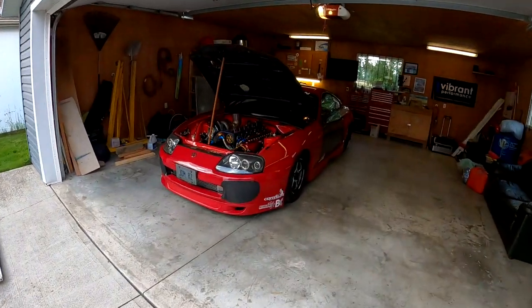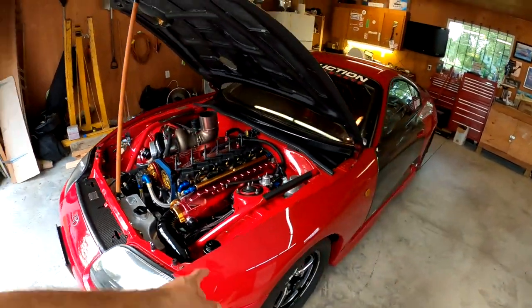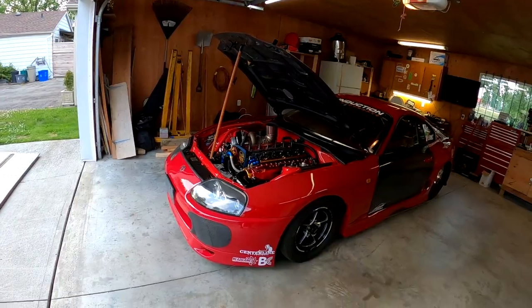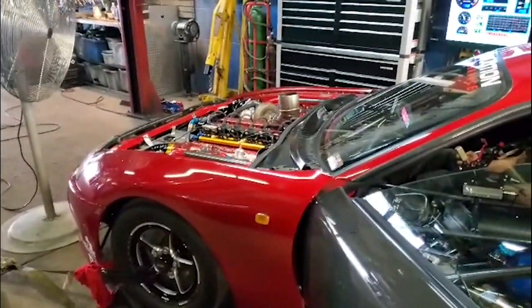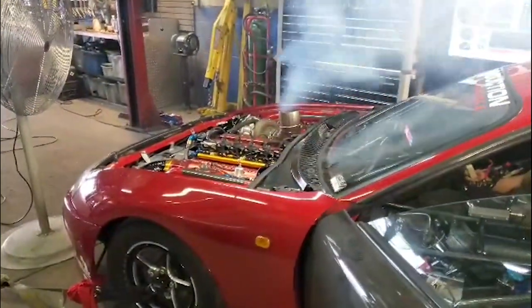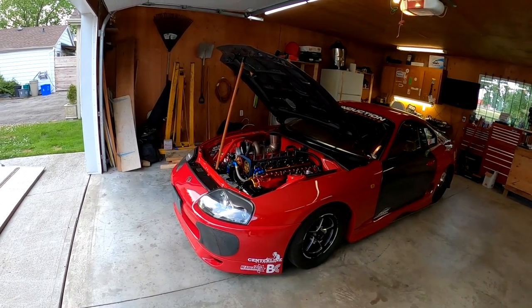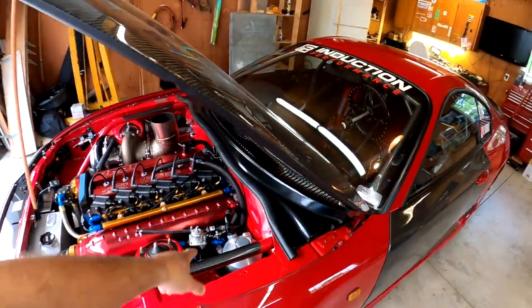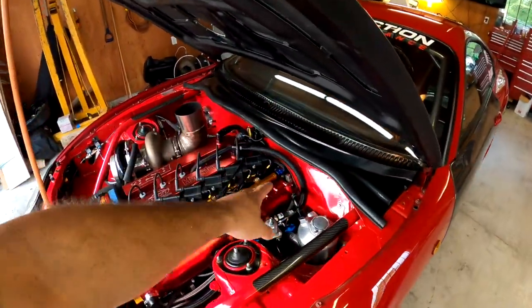So we'll talk about the car a little bit. We're racing Sunday — it's quarter mile, the car is ready to go. We took it on the dyno. We basically did a pass on Wastegate and it went very well, apart from the smoke at the end. That's because the catch can hoses weren't big enough. I kind of switched some things around from last year. I had this big hose last year and it was pushing a lot of oil through it, so we're trying to find a different way not to waste all the oil.